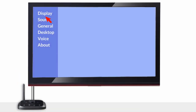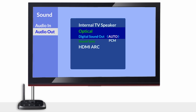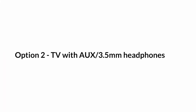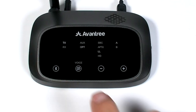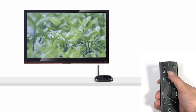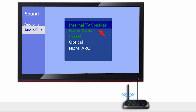Next, go to your TV settings menu and set your audio format to PCM. We'll talk about the auxiliary port. If you have this, it's just as simple — connect the transmitter to your TV using the auxiliary cable provided. You should see the AUX indicator light up. If it doesn't, press the AUX OPT switch once. Now you should be able to hear your TV through your headphones. If not, check to make sure that your TV speaker has been set to headset.